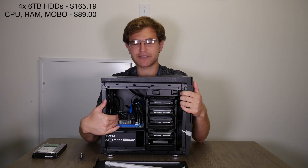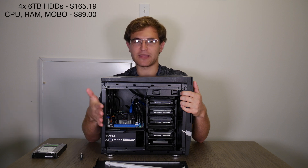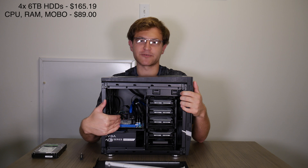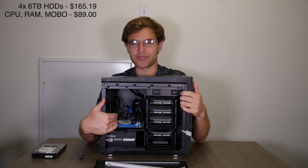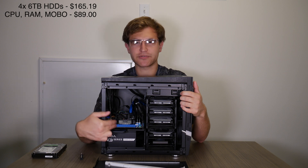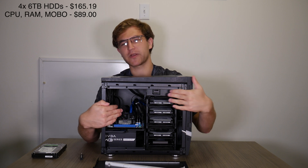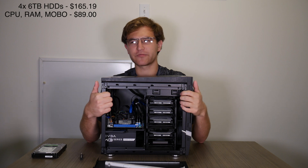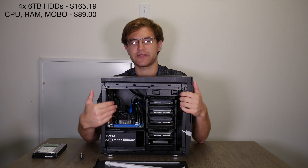This is running TrueNAS and depending on where you look on their website they either claim a minimum of 8 gigs or minimum of 16 gigs of system memory. It seems like 16 gigs is recommended and 8 gigs is required, so we're running at the absolute bare minimum. It would probably be beneficial to upgrade to 16 or even 32 gigs if you can get that in two sticks of DDR3. The reason I chose this particular motherboard is because it has six SATA ports, and when running four hard drives plus a boot drive you need at least five — most mini-ITX boards only have four.